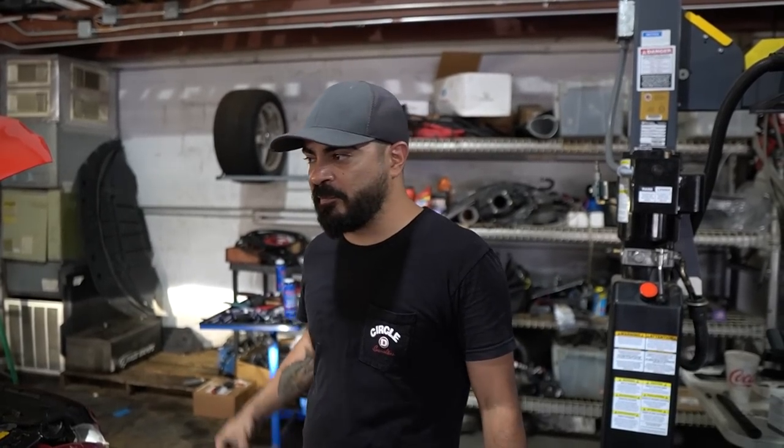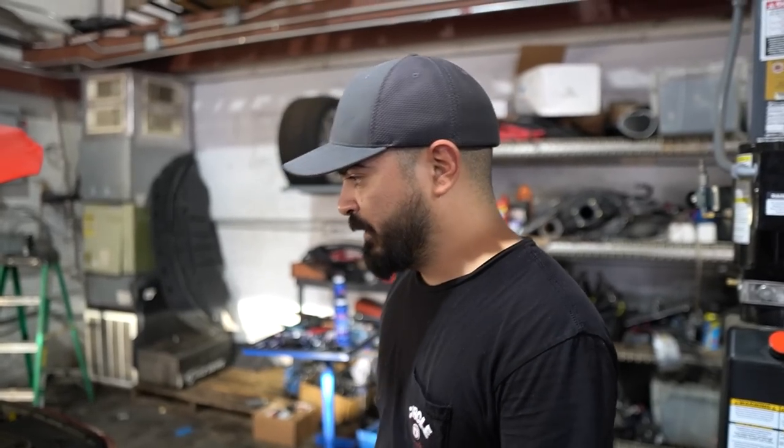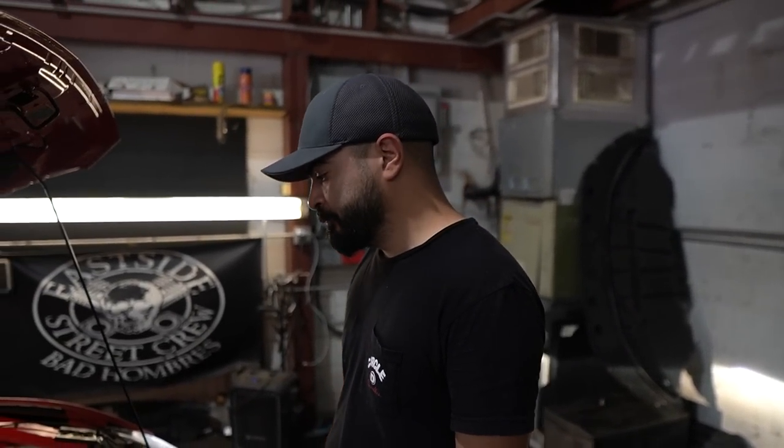Something like this was hand-built. I'm not sure if Ford did a break-in procedure at their plant when they built this thing, or if we gotta finish it. I know they provided the filter, the tag, and the guy that worked on it. I'm gonna let it run for a couple of minutes to make sure nothing else leaks, get it up to temperature, shut it off, check all the levels. The coolant — that's topped off all the way. We always vacuum fill them and they always get a perfect fill that way. The other reason we vacuum fill is because if there's a leak, it won't build any vacuum when you put the machine on it. So that part I'm not worried about. What I am worried about is any oil leaks, any transmission leaks, any work noises, belt squeaks and stuff like that. If all that checks out, it goes over to Brian.